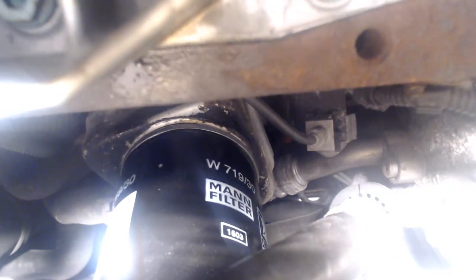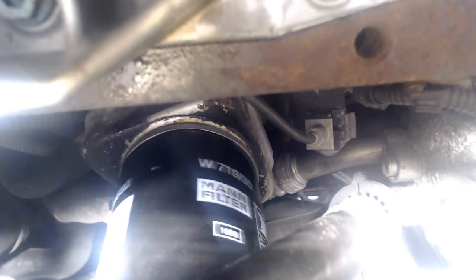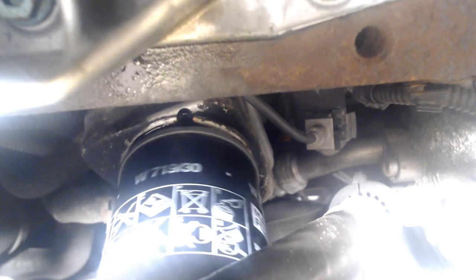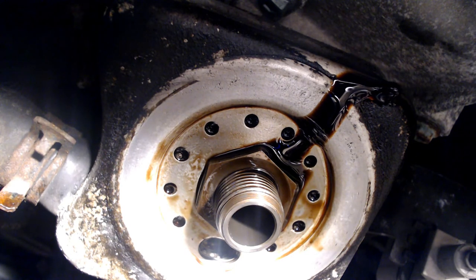The filter is located in front of the engine block and shrouding in a maze of pipes and tubes. It is accessible from underneath still and fairly obvious when you see it. You should be able to unscrew this using your own hand strength but if not, wrap a filter removing tool around it and unscrew anti-clockwise. It is a little tight for space under here so take your time and try to keep the filter upright. It will contain oil still despite the draining. Here you can see where the filter mounts onto the car. It has come away nice and cleanly but worth giving this a good wipe to remove any bits of rubber seal or dirt that may be left behind so you create a good seal when refitting the new filter.